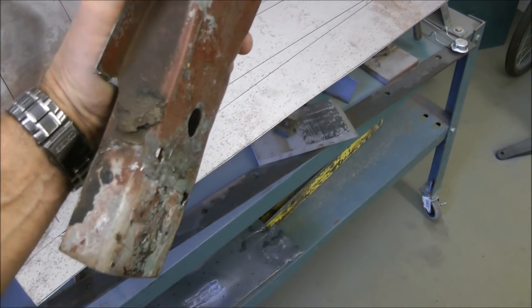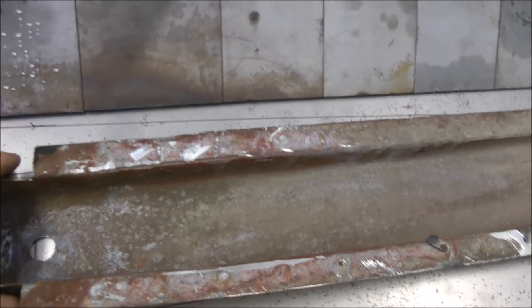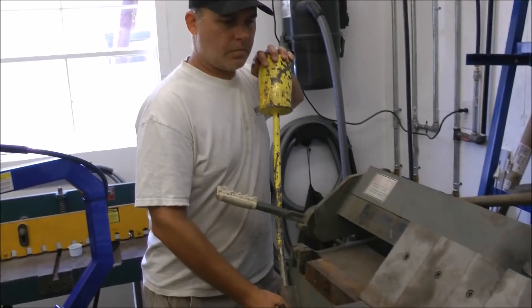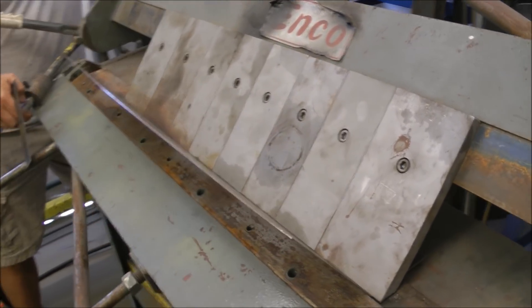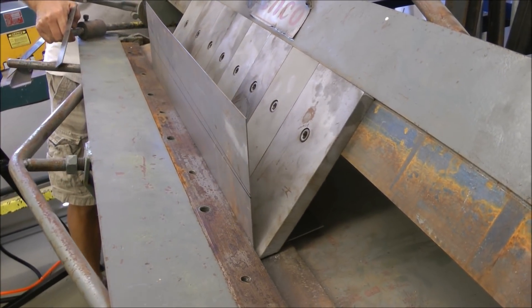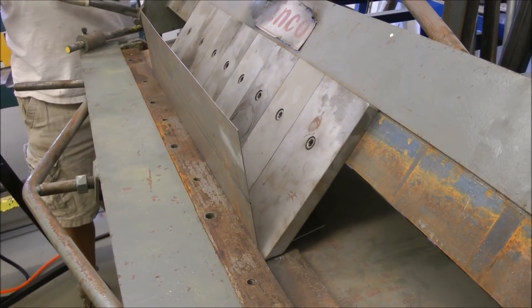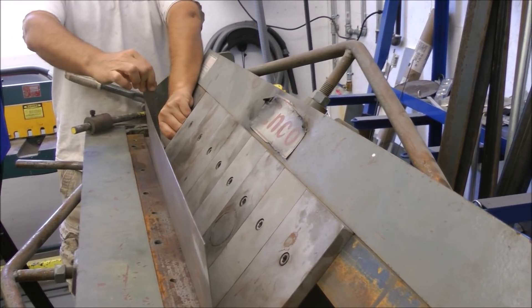To reproduce this factory floor reinforcement, Joe has laid out the lines here. You'll notice everything's sort of a wedge — that's because this piece itself is a wedge, and those lines will ultimately fold up into these creases and give us this piece. It looks pretty darn square on the first try. Very good — close enough for government work.